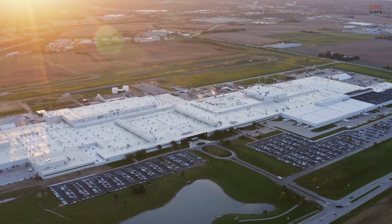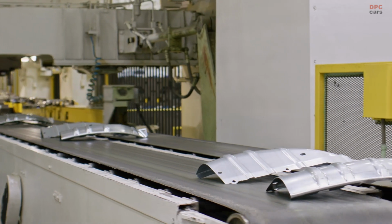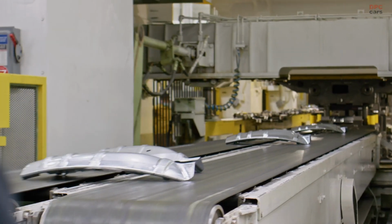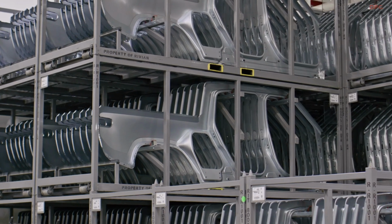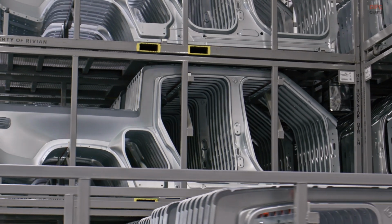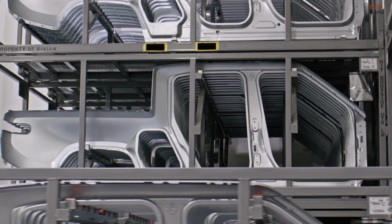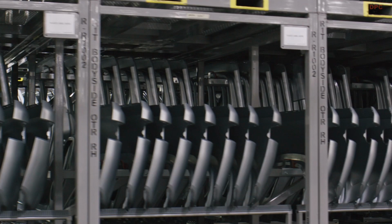Of course, not having an engine gives us some advantages, but the way we've laid out the architecture, we have what we call a skateboard architecture, where essentially the whole lower half of the vehicle, all below the wheels, we carry all the core elements necessary to drive the vehicle. So your battery system, your drive system, your cooling system, the entirety of the suspension, all of our digital and network architecture carried in this thin skateboard platform.